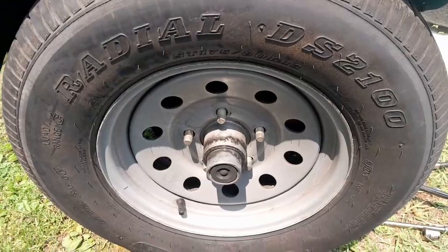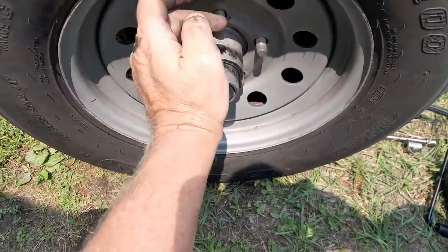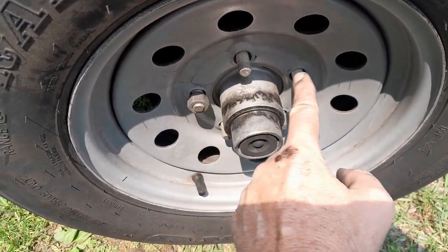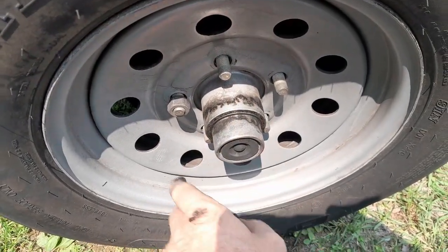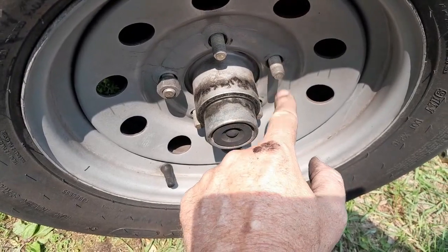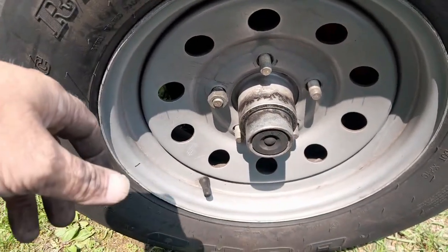I got the tire back on — I haven't put the lug nuts back on yet. Typically I just somewhat hand tighten them first, then tighten them all up. Anytime you're dealing with something like this, tighten one and then skip one or two, going to the opposite side. You want to randomly do those: snug, snug, snug, then tighten them down good. You're skipping one every time you go — that tends to work well.